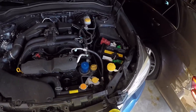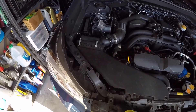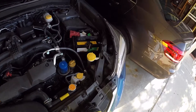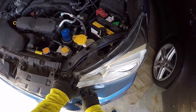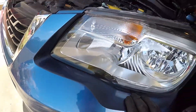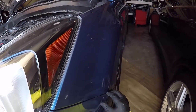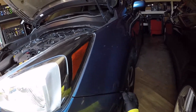I do recommend that you get a helper when you're ready to remove the bumper. It isn't heavy but it's pretty big and you don't want the bumper to fall down and damage the paint. After all the rivets have been removed, the bumper is held into place by plastic clips that attach basically underneath the headlight and on the side of the fender where the bumper and front fender meet. Grab that side, give it a good hard yank, and it will start to come out — take it slow with steady pressure to avoid damaging the clips.